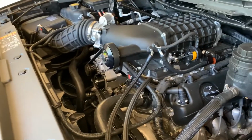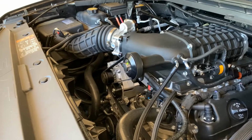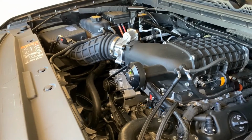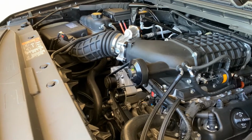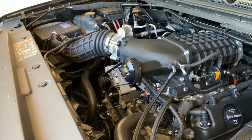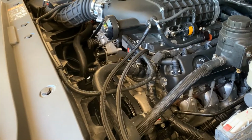I was watching some other YouTube videos, this P Moore, I don't know what the numbers are, but P Moore was the first on the guy's channel. He's pretty smart. Kind of followed his advice on getting the timing chain off, walking the chain off without having to take the oil pump and drop the pan. So that was kind of a pain in the ass, but anyway, it does come off and you can get it back on.